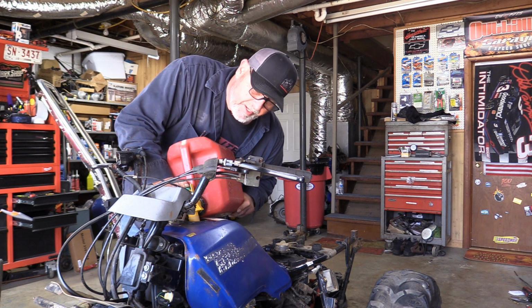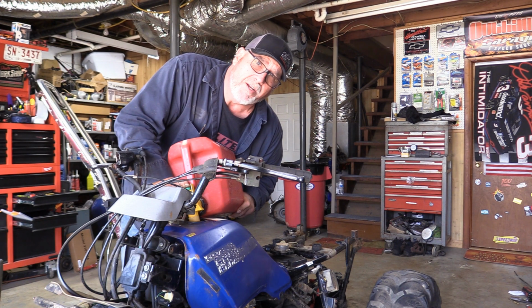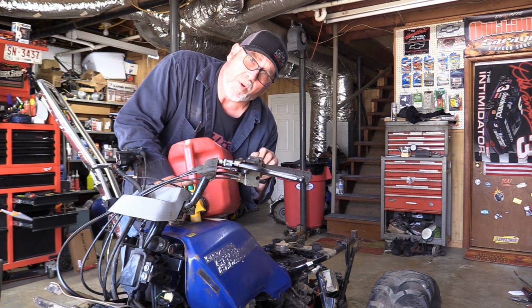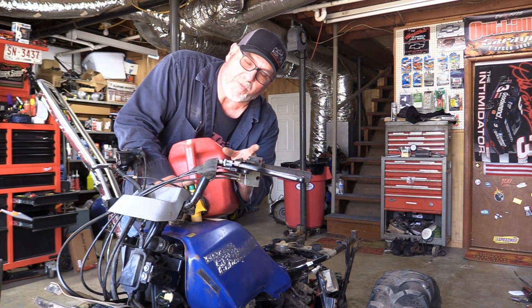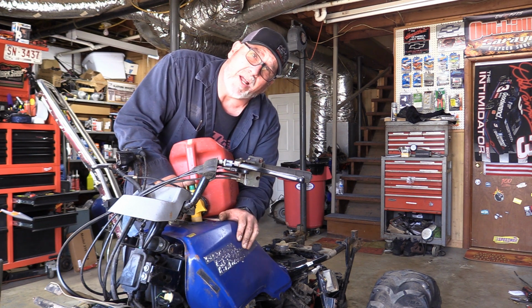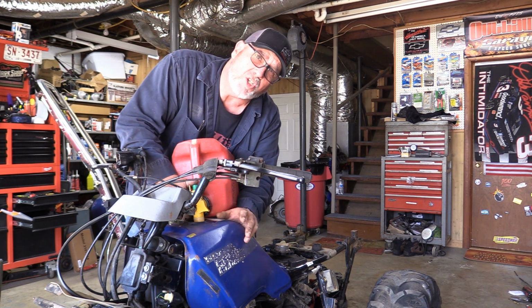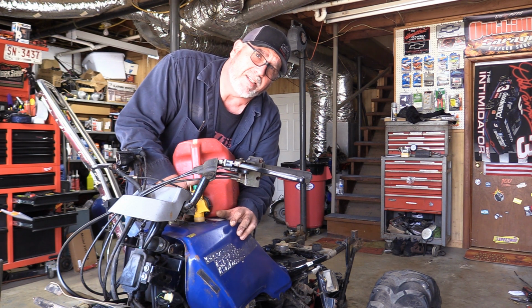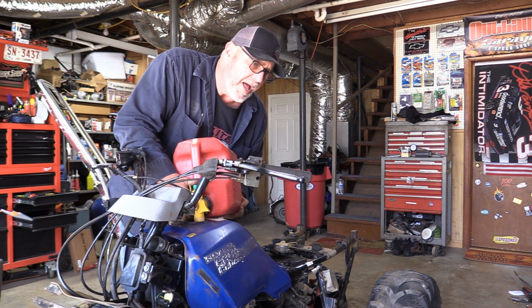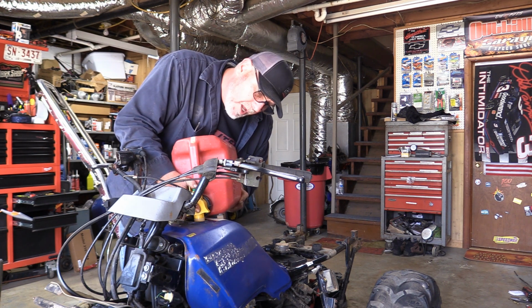One trick to gas tanks like this is they make carburetor cleaner in like a gallon, or it's in a can where you can dip your carburetor in it. Just a trick for y'all. If you get any of these old 300 tanks, Bayous, whatever, and they got a little spotty rust in them, you can pour the contents of that in here, and every day for about 2 days, shake it up and drain it out, and it will take just about every bit of the rust out of these tanks. So just remember that. I'll see if I can find a link and drop it in the description below.